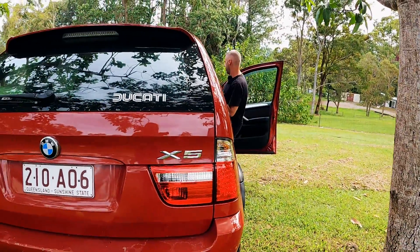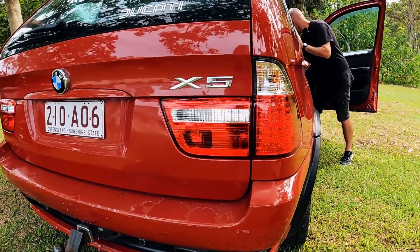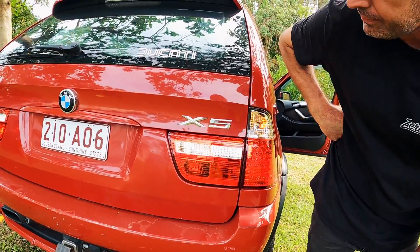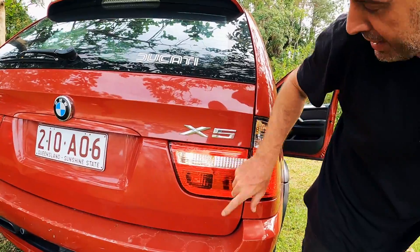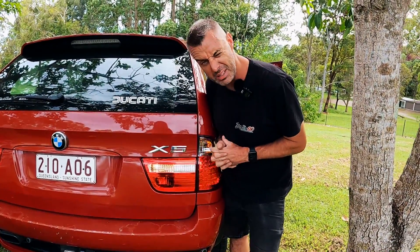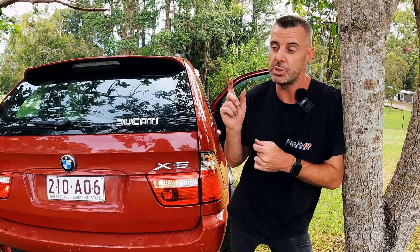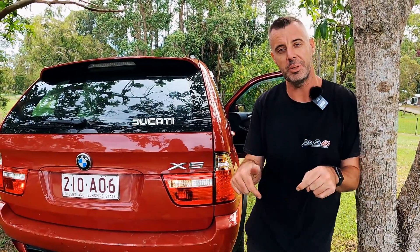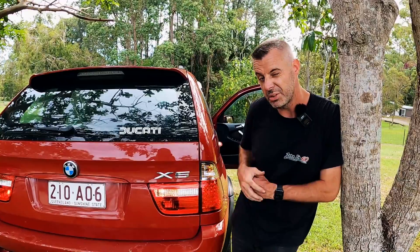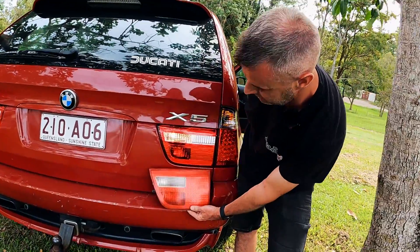Brake lights on - isn't that a more modern look! Love it. And the fog lights - looks like I've put them in the wrong way: fog light where the reverse should be. I'm not going to film fixing that. That's another thing to check when you do these - make sure you get the fog light and reverse light the right way round. The biggest thing about doing this job is switching the wiring around between pin six and pin four for the earth wires. I'll put a link to these in the description. Pretty good quality lights - the same ones I had on the X5. Still got the flicker issue but pretty good. We paid just under 300 Australian delivered.